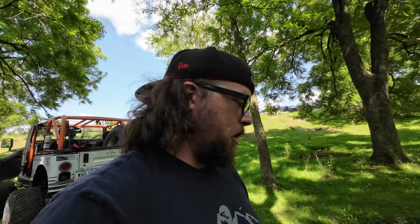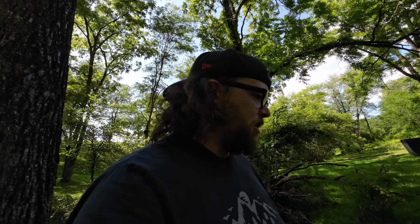I think I saw what I needed to see, but since I'm here, you think I'm going home yet? I'm gonna hit this a couple more times and see what other little lines I can find down here. I could feel both tires spinning instead of just one. There was a time or two where I saw my driver's tire stop and I feathered the brake a little bit and it started spinning again right away, which is how it's supposed to work, but it never really wanted to work when I had just the 400-pound spring in there. Now it seems like it's working a lot better, but obviously I'm not gonna let one climb determine that.